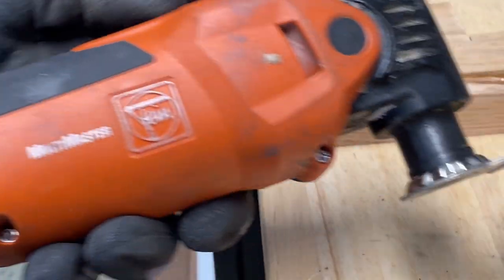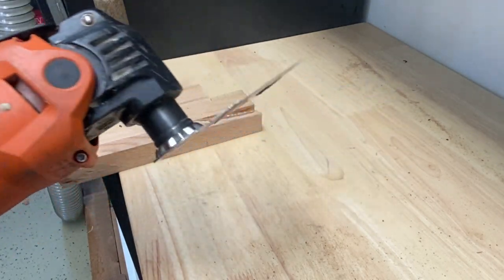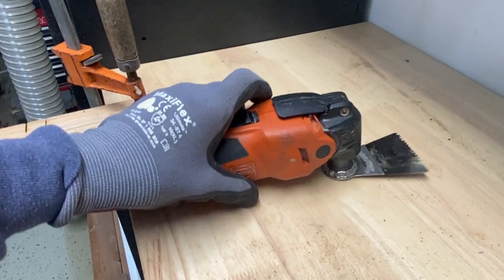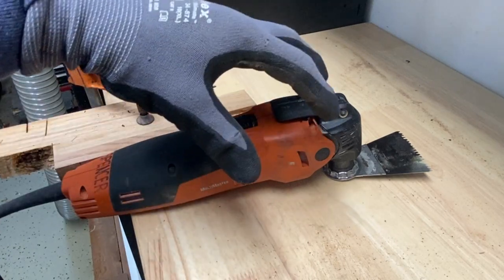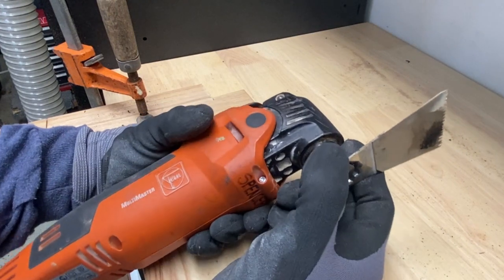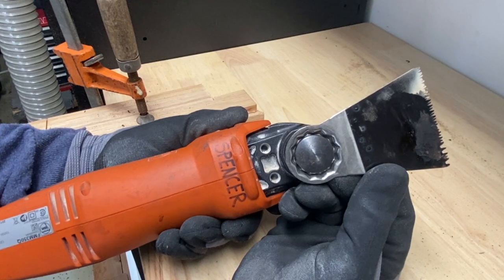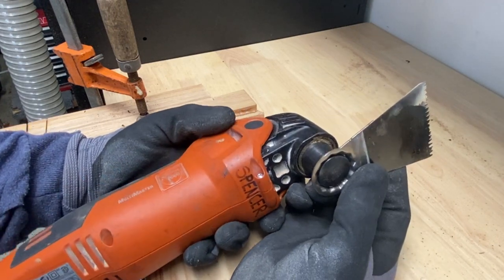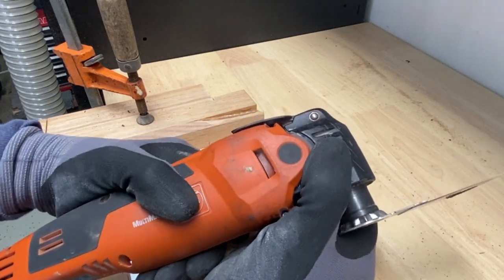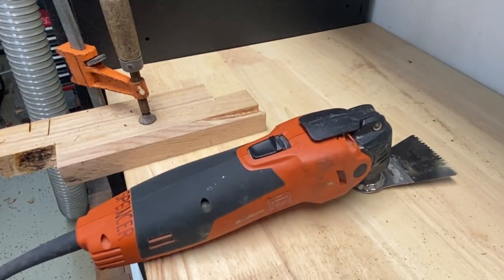Little smoke. Happy with the way it performs. Like I said, it actually wasn't working that well for quite some time, and I wasn't really paying attention to those screws. But as they loosen up, you don't get the oscillating vibration up at the head here, so you lose a lot of that, and so therefore it doesn't cut the way it used to. So after gluing that and making it solid and having this housing, the head connected solid to the housing, boy, it cut through that oak like a breeze.